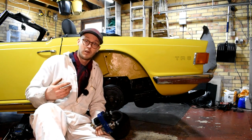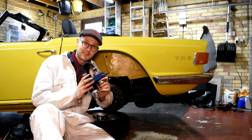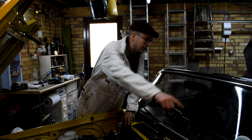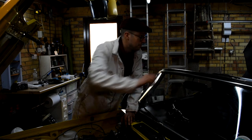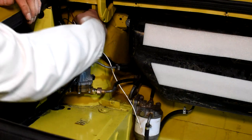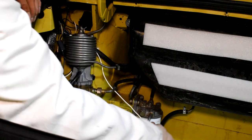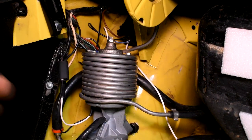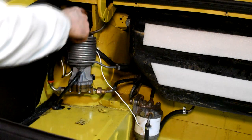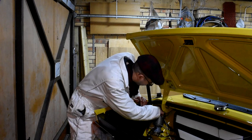I'm going to run through with you what I've done so far with the car as regards to the wiring, and then we'll get on and fit this new fuel pump. To start with, I've hardwired in a 20 amp inline fuse direct from the battery, and that runs down here through the bulkhead and along the side of the original wiring loom all the way into the boot where it meets the relay. The relay is positioned in the boot, and the feed wire comes through and goes to the new fuel pump on the outside of the boot panel. We're utilising the original wiring loom which comes to the current fuel pump — it has feed and earth — and we're using those wires on the relay as the trigger wire.